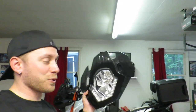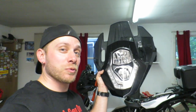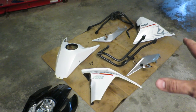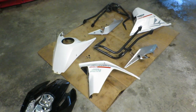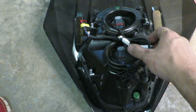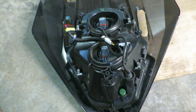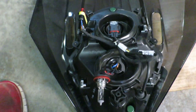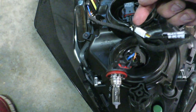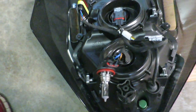I feel such a sense of accomplishment because we finally got the headlight off. Now let's grab the Cyclops parts and get them swapped. One other thing: if you've got a piece of pasteboard, it's a good idea to lay your parts down on it so nothing gets scratched while it's off the bike. With the headlight facing down, we're going to take out the low beam and the high beam and replace them with the Cyclops bulbs. If you've ever replaced a headlight bulb, it's pretty simple — you just twist them to get them out. KTM has a tie wrap on the back; I'm going to cut it to make it easier to get to the plug-ins.